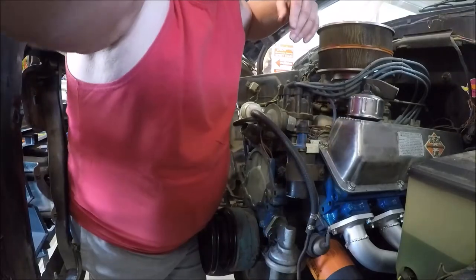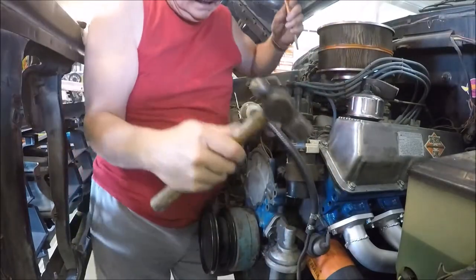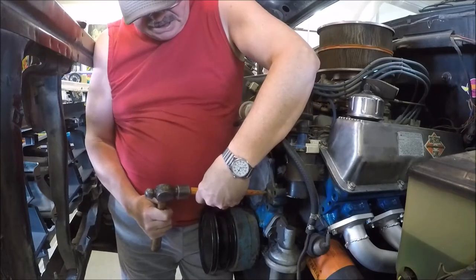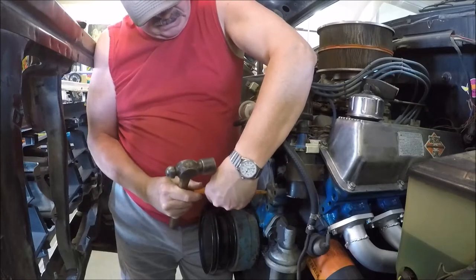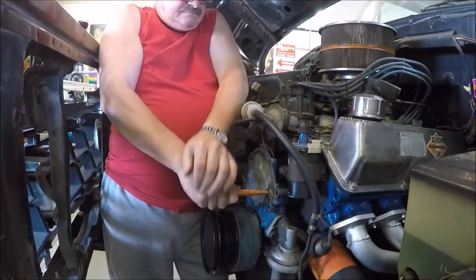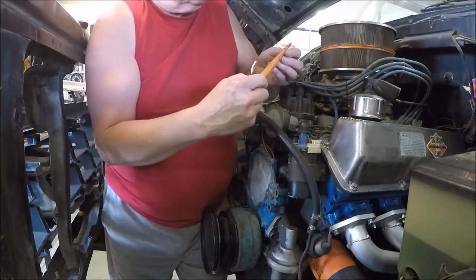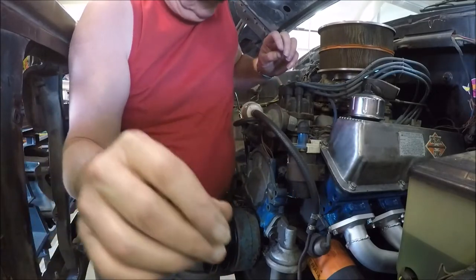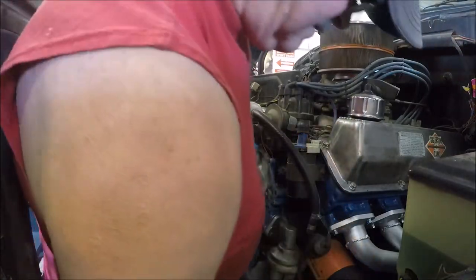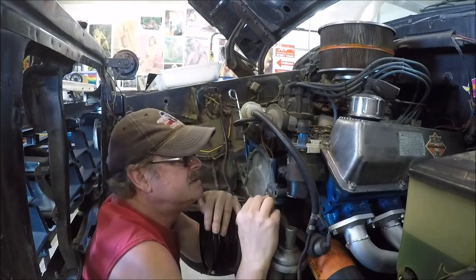And one last thing to do before we're done is we knock out the tang on the Heli coil so that the bolt can extend through there. So, oh dear, I certainly didn't do that. Took a bite of it there. I didn't think it would, but it did. Now, to figure out if I did get the tang out, I'll have to get something else to stick in there. That's too fat. Speaking of which, this doesn't get any easier. It certainly looks good anyways.